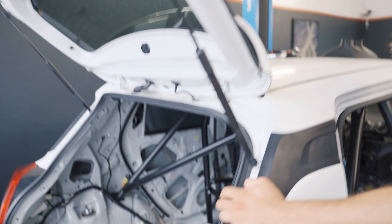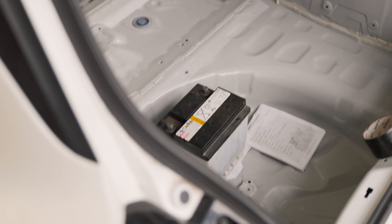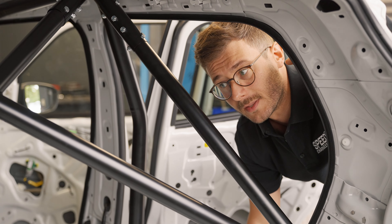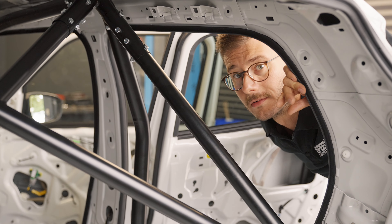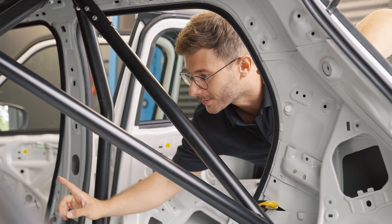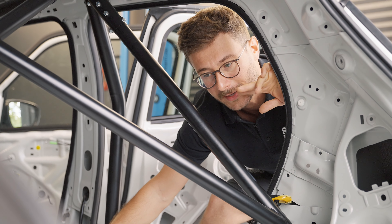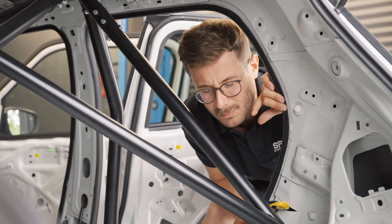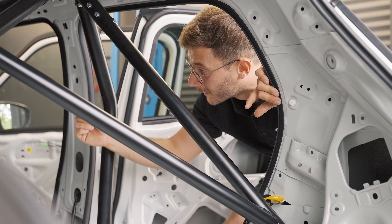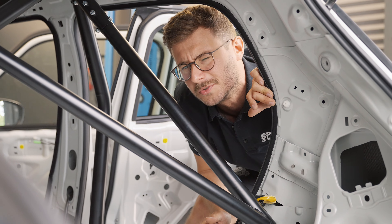We are moving the battery from the front to the rear. Why? Because there are much lighter batteries available, but more importantly, the weight distribution — the perfect wheel load from front to rear — is more important than just being light. We are calculating and trying to have an accurate wheel load. We won't have 50-50 because the car is too light in the rear, but the battery will help. We are getting rid of more than 10 kg from the front and moving it to the rear to help with weight distribution.